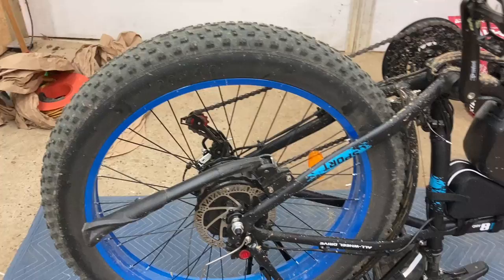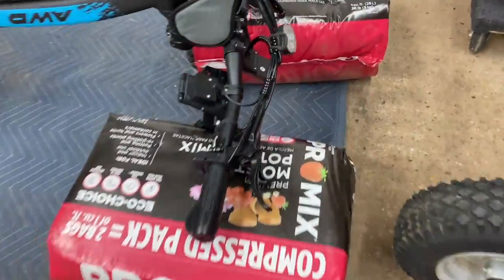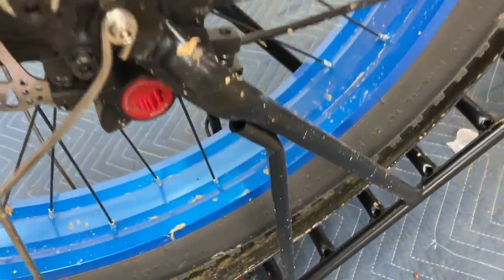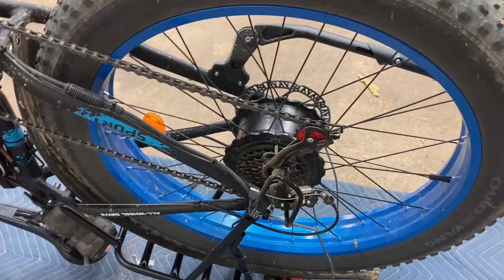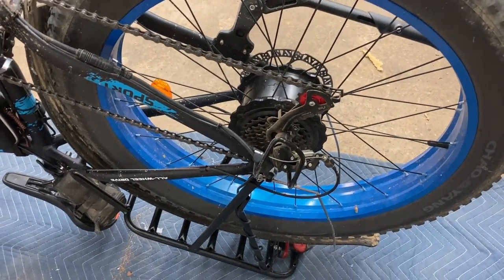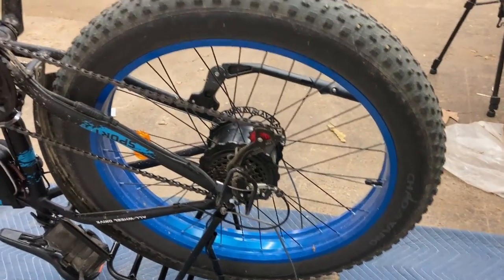What I'm going to do is put that on there because I'm not going to wait another week. So let's get going on that. What I've done is I've tipped the bike upside down and put it on top of something to keep the display off the ground, then pulled the cap off of this side, and this one just slides off. On my EcoTrick I did it upright and it was just hard to get everything back where it was supposed to be, so I'm tipping it upside down this time — I learned from my mistake.